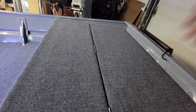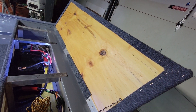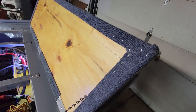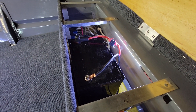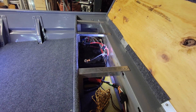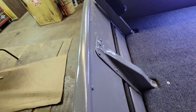Up front, this was the original front seat — extended that out 14–16 inches or so just to hold batteries up here. All the framing is one-sixteenth, inch-and-a-half by inch-and-a-half aluminum. All the deck work and floors is half-inch BCX that have all been fiberglass resin coated both sides. Carpet is just an Amazon carpet, but it's an actual 20-pound — it's a decent carpet for what I paid. Up front we're gonna have 200 amp — LiFePO4, not lithium-ion — LiFePO4 batteries, 100 amp. I'll run two up here. One will just be for trolling motor, bilge pump, and nav lights. The other one is all the accessories. Everything has got Anderson connectors, so everything is swappable between circuit one and circuit two. Wiring is all run down the side of the hull, all loomed off nicely.